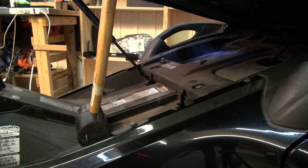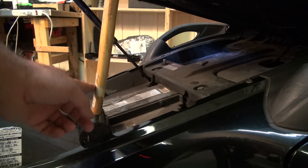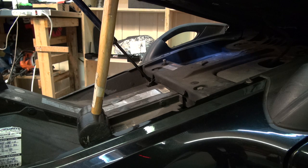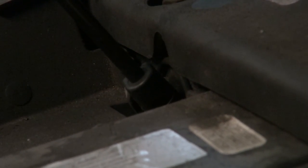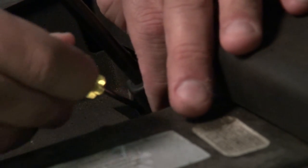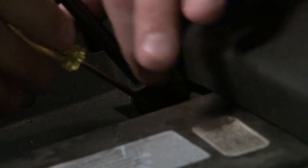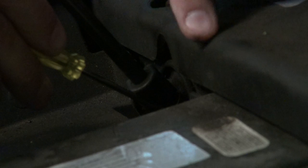To be able to remove the seat, the first thing we're going to do is take out the cylinder that helps you bring the seat up when you want to gas your bike. I do have some help — I got a little hammer I put here to hold the seat. Mine is an ultimate seat and it's really heavy, and it's a little cramped where the backrest is, so it's actually putting pressure to bring it down. You're going to need a flat head screwdriver — if you've got a little one like this, it's going to be able to do the job. Get in there; there's a little clamp, and as you insert the flat head screwdriver you can pull it towards the outer edges and the cylinder is just going to come out.